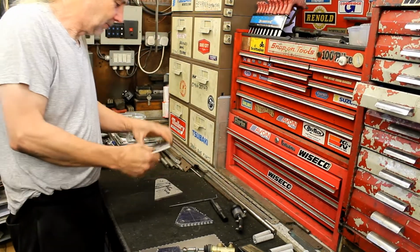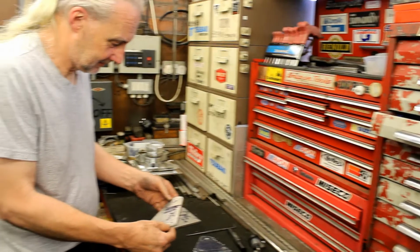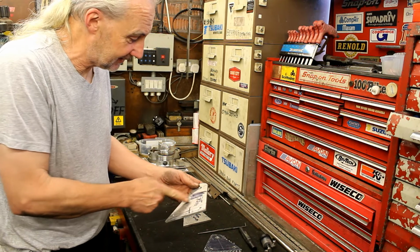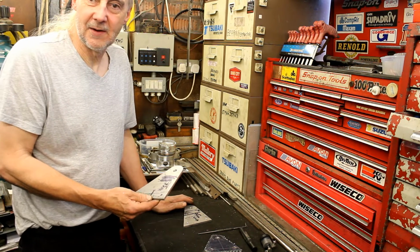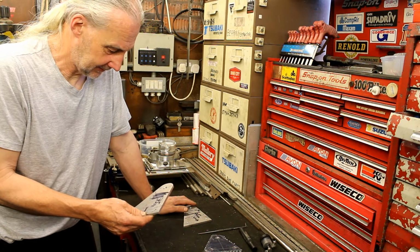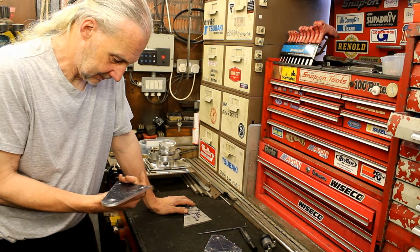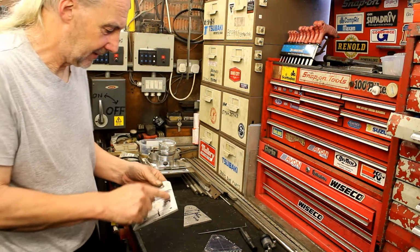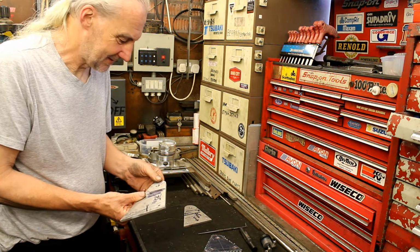So we'll do that right, and then the brackets for the headlamp over there to your left, Jeff. You were surprised that I said take them down by 75mm, and you might be right, you might be wrong. So I'm going to take them home myself. I know they're longer than what we need. But I didn't think when you said take them 3 inches, it is a lot. I'm basing that on getting the back of the headlamp shell up against the headstock. It's still a few mil away from it, but maybe that's too much because I'm not thinking about where the wiring and the details of the instrumentation will go. Well, if you want, I can mill them down and take them smaller. There's still a lot of faffing about to do with them yet, so let me take them home as is.